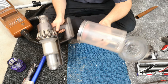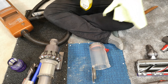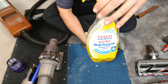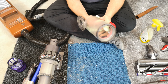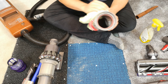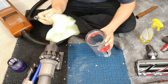This isn't a machine that you can just pull the trigger and not care about — you do have to put a little bit of maintenance into it, which you should do on every vacuum cleaner really. I've just got a little bit of general purpose spray — it's not going to rot the plastic or the rubber seals — and I've just done a spray on a cloth just to get the dust off. The problem with Dysons is that they're very static and the dust in the air clings to them, both outside and inside.